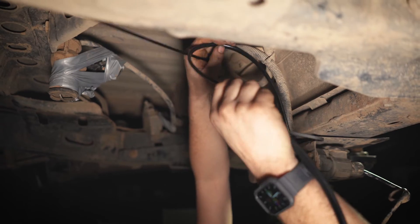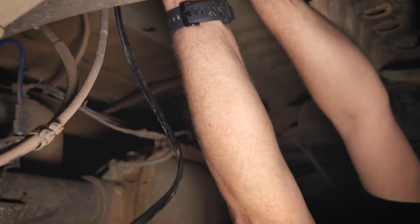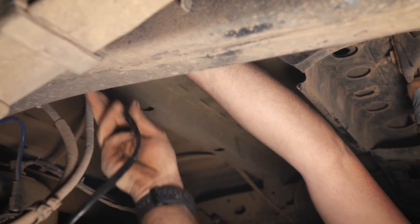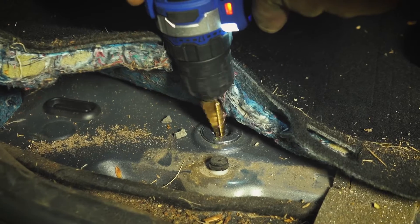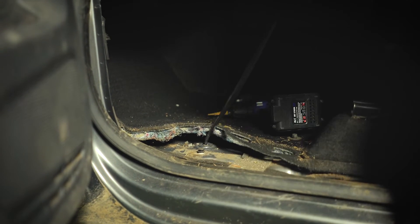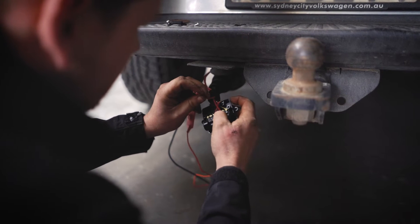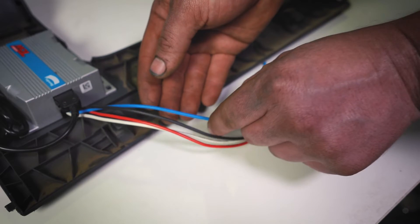This will give you the best signal when wiring up the red wire. If that's not an option on your vehicle, any point that receives a straight DC voltage should work fine — for example, you could tap into the top rear tail light, brake light relay, or the wire connecting to the stop lights on the trailer plug, which is what we're doing. On late model vehicles, we don't recommend connecting the red wire to the cold side of the brake switch as this can potentially cause damage to the vehicle's body control module.